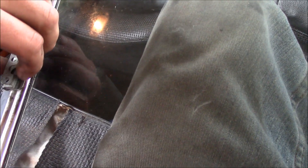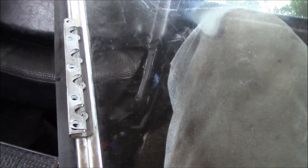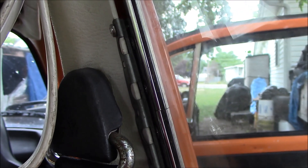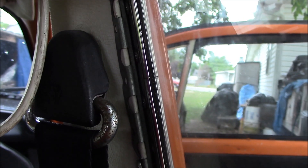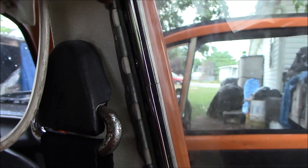These windows are original German VW windows. I put new seals on them earlier — didn't show you how to do that, there's already enough video on that. My best suggestion is to use a lot of silicone lubricant and a piece of plastic — I use a piece off a mouse trap — to shove the seal in all the way around. This is the metal bar that everything screws into. You shove this bar in under here, then you get the edge of the window in, bar goes on the back side.